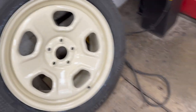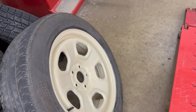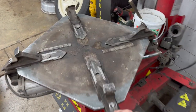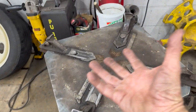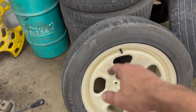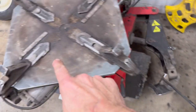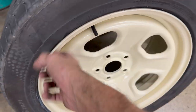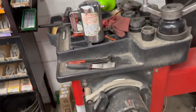I'm really happy with that — I think that has just the right look that we were going for, and it's going to fit the style of Curtis just right. On the tire machine, I clamped the wheel from the outside just because I didn't want to put marks and scratch up the inside of the wheel that we also painted. I'm also going to be doing kind of a static balance on this thing because the outside lip is going to be exposed, so I'm going to make sure that all my wheel weights stay on the back side of the wheel.